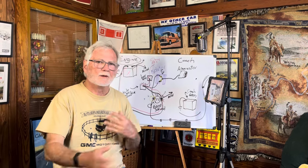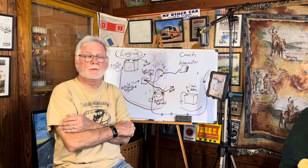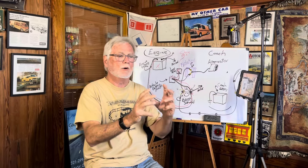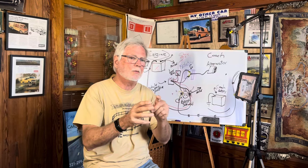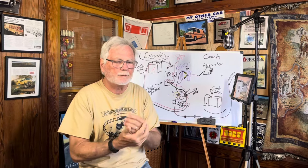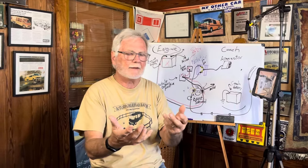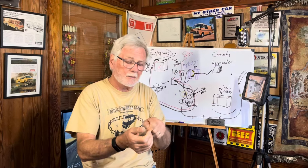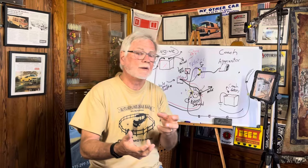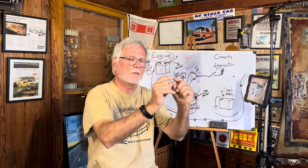When we were at Bessemer, we did a walk-around test and found that one of the bulbs was out — it was actually intermittent. Going down the road, one of the turn signal lights would come on, then go off. The system is set up so that if you have a bad bulb, it will tell you by that circuit coming on. We checked all of them, found one that was bad. Pulled the lens off, went to pull the socket out, and the whole bulb came out of its own socket. Then while we were digging, the whole socket blew apart. It was fortunate that Mark had one — we changed that whole assembly, because that one little light told us we had one bad bulb.